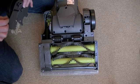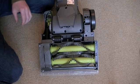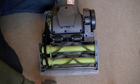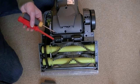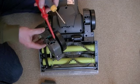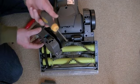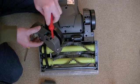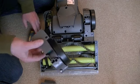To replace the brush roll, first remove screws numbered five to eight from the back part that also incorporates the wheel — put that to one side. Then remove the screws on the front part of the belt guard, numbered one to four. You may need two types of screwdriver: a crosshead or Phillips. I found that at screw position number seven the shaft of my screwdriver wouldn't go all the way down, so you might need a screwdriver with a thinner shaft to undo screw number seven.